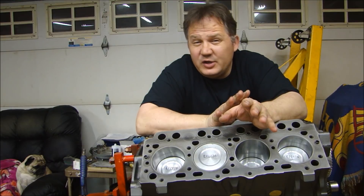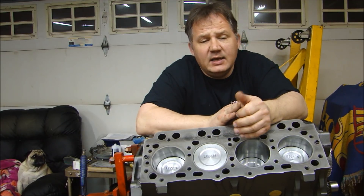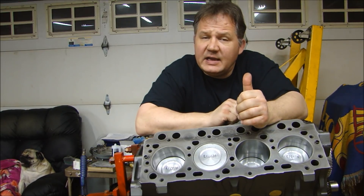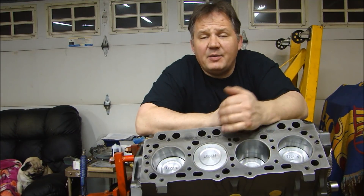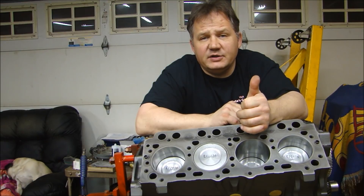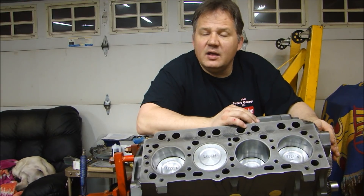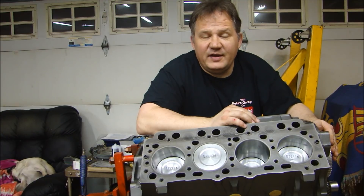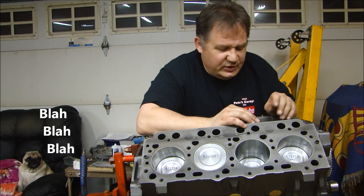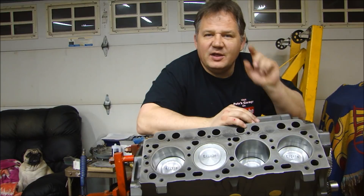So I know that was a short video — just putting in the camshaft, putting on the cam retaining plate, checking the end play for the cam, and putting on the gear and the eccentric for the oil pump. But before I put the front timing cover on and before I put the oil pan on, I want to put the heads on, put the lifters in, and put the rest of the valve train on top — the rocker arms. I want to turn the engine over by hand and make sure there's no interference with the valves and the timing is correct at top dead center. Because there's always a chance your camshaft timing is 180 degrees off, and you want to find that before you put it all together, before you put the front cover on — otherwise you'd have to take it all apart. So next we'll do the heads, valve train, lifters, push rods, rocker arms, and we'll check for interference. Thanks for stopping by Pete's Garage.